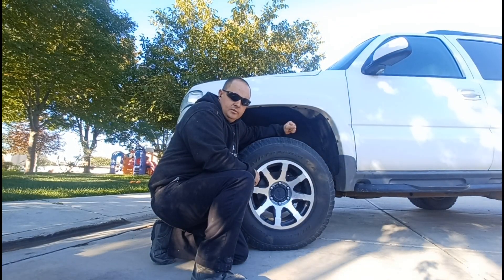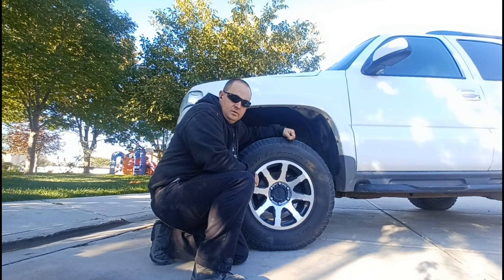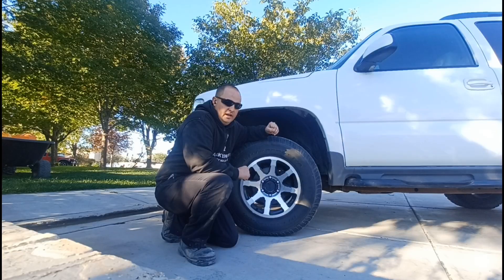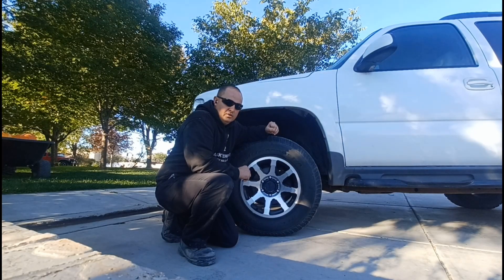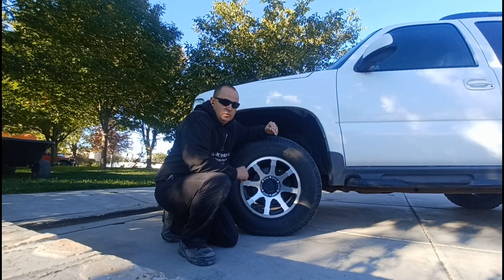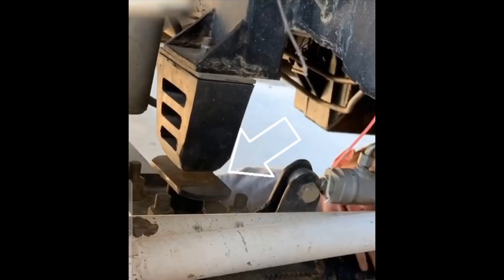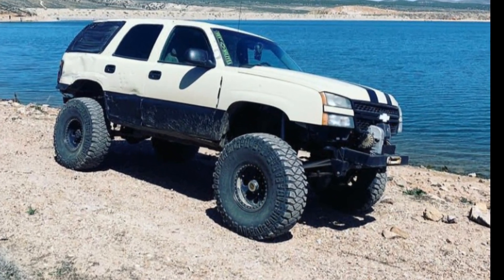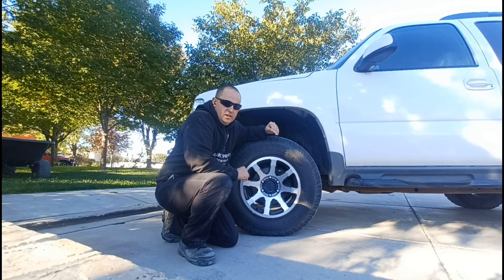Here's a Ford Super Duty — what is that, like an inch, inch and a half also? And if you look at some of the other builds that people are doing for solid axle conversions, they don't have very much at the bump stops for upward travel, and their center of gravity is usually quite a bit higher. For example, this one here has an inch and he's on 40-inch tires. So the Tahoe overlanding axle swap is spectacular in the amount of upward travel it accomplishes.